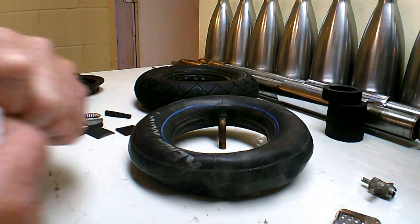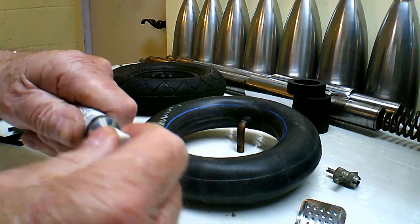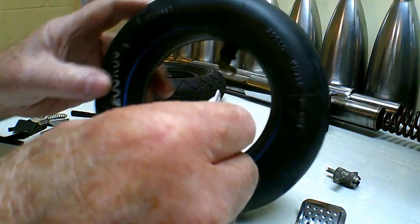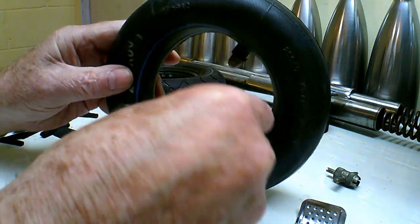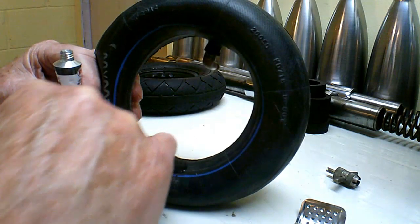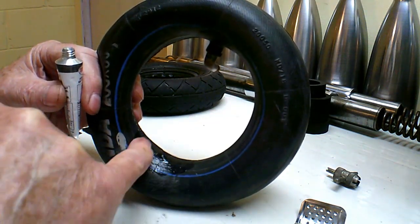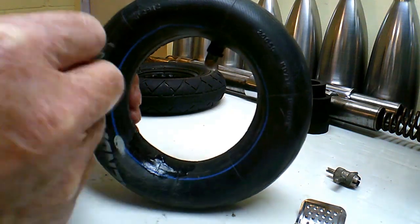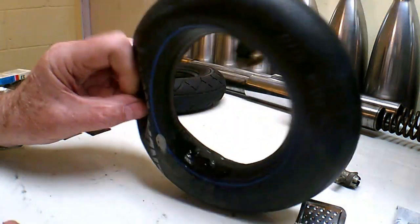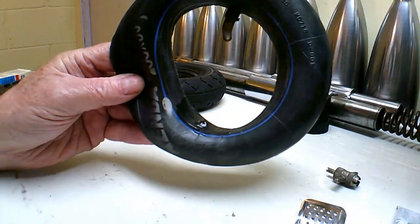Then you have to put some of this glue on there. If you buy something and it's been sitting around a long time it's no good, so use fresh glue to put on the hole in the tube. Smear some glue around on there — that's basically all you do. Just smear it around the hole. Make sure your hands are clean when doing this because I don't want the patch to come off again. I don't want to be stuck on some runway with no tailwheel. It's pretty stinky stuff, and now we're supposed to let it dry before we put the patch on.